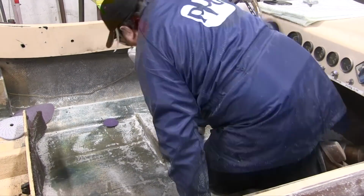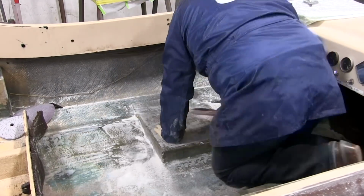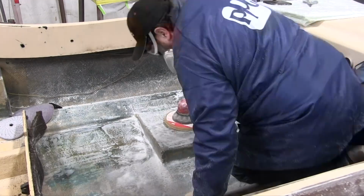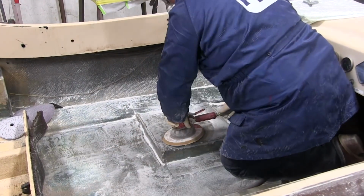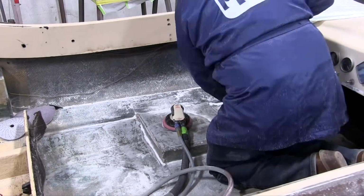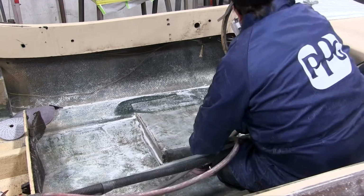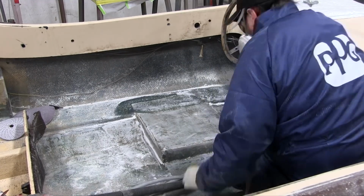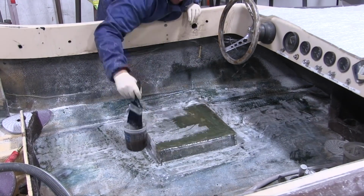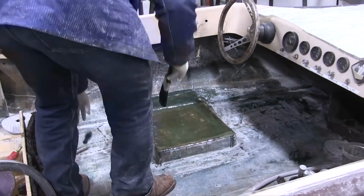But if you are needing details on mixing the resin and laying down the fiberglass, I do have a part 1 video where I'm real thorough about talking about that, and I show you how to mix it up. So if you need to view that video, I've got a link down in the description for part 1. Now I'm using fiberglass mat because it's really strong, the strength that it has in resin. Now some of you may prefer to use an epoxy based fiberglass for marine purposes, but I decided to stick with what I know, and that's just the traditional fiberglass repair like you'd use on a car. I know how it works, I know how to mix the resin, so I just decided to go with that. I mean, it's good and strong, it's waterproof, so I think it'll be fine for this repair.